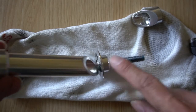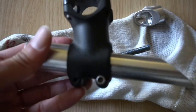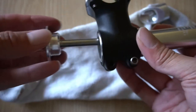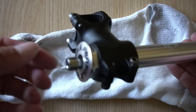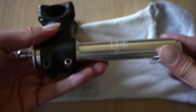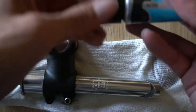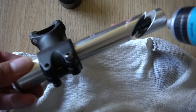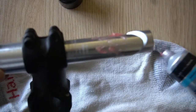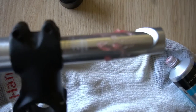Because the cap is wider than the top of the adapter, I'm going to stick the stem on first. Then I'll slide the top cap in and thread the adapter on. Even though the inside of my fork is not carbon, do this part at your own risk. Remove the cap and put some carbon assembly paste along this area and on the adapter — it's a little gritty, so it should help hold the adapter in the fork better.